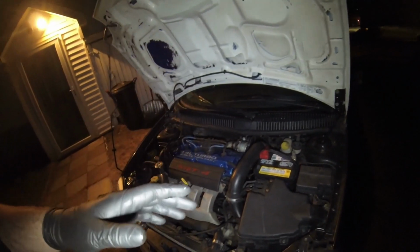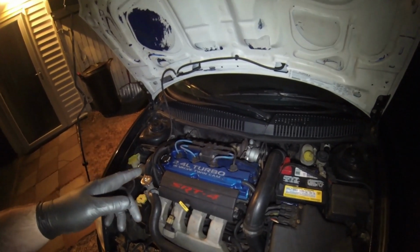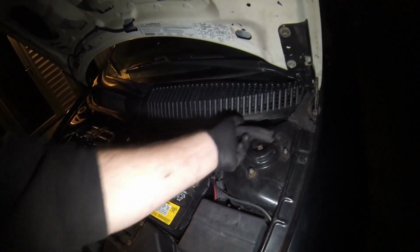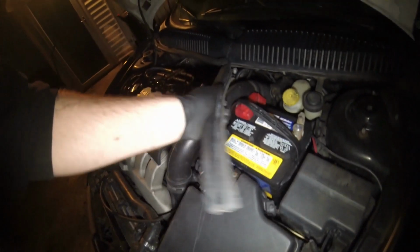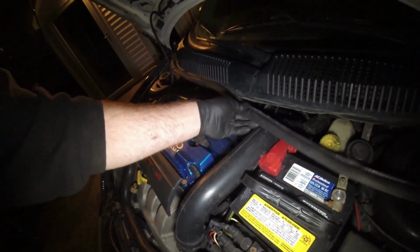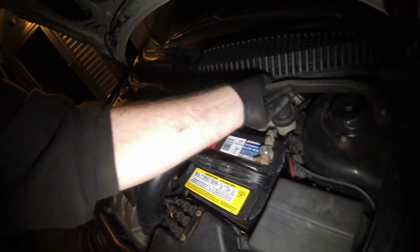I did run out here real quick just so I can try and show you that seal that I was talking about on the blue car when you pull the cowl off. This is that seal. It's no different than a weather strip in the door. Basically, you can see the channel, how it squeezes together. The metal's broken in it, so pieces of it aren't grabbing too well, but that's all it is. You just pull it off, and then once you're ready to go back together, like I said, you just kind of take it and push it back on.